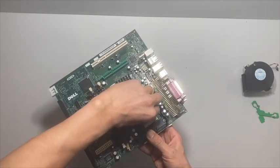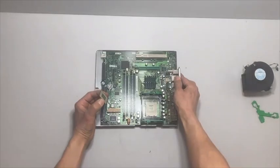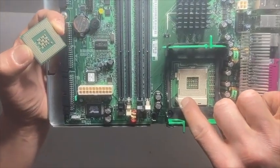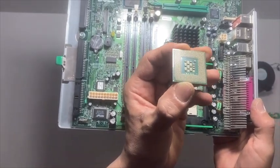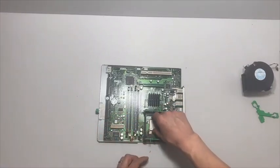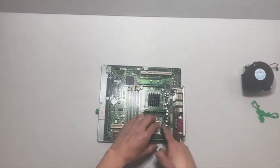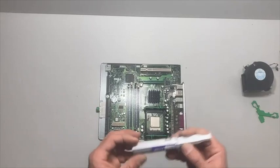You've got to lift up this lever. These are made for zero insertion force, so it should come right out. Just be very careful with the processor not to bend any of the pins while you're handling it. Then lift up the lever on the new motherboard, and make sure that the processor is lined up correctly. As you can see, it's not 100% square — there's one corner that has a couple pins missing. So you just need to make sure to get it in the right orientation. If you have it correctly, it should just drop right into place. Don't use any force because you'll end up bending the pins of your processor. Once it sets in, just put the lever down, and then we've got to apply some thermal grease.